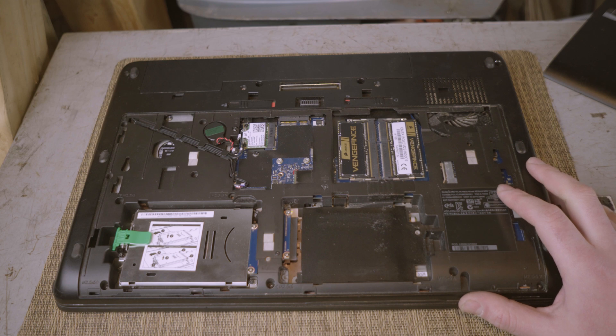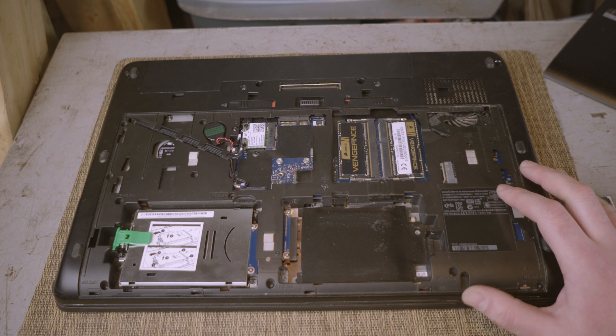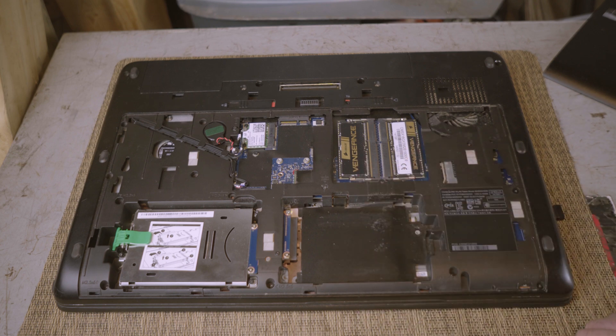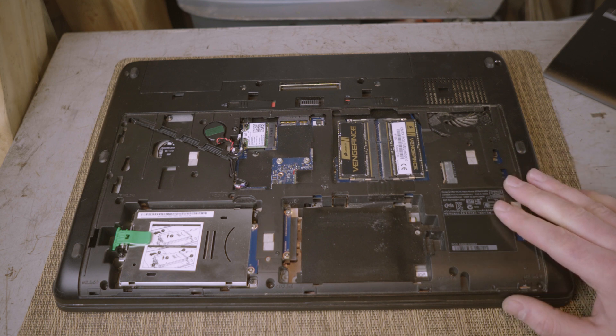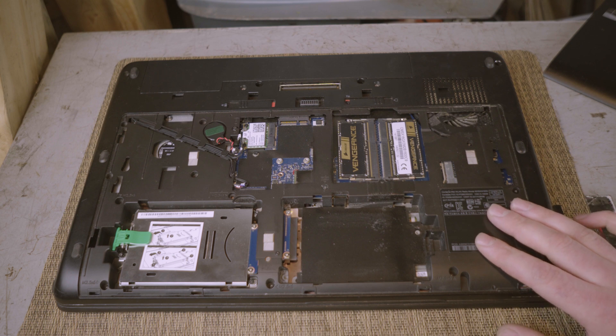When I took off the keyboard again, I decided before unscrewing the GPU and dealing with all the thermal paste, I'd remove the two RAM slots on the inside of the laptop that you don't normally see. I removed them, plugged in the laptop, and it powered on with no issue — it was honestly kind of amazing. I spent almost an hour fumbling around wondering why the computer wasn't booting and whether the eBay graphics card was bad. I then turned it off, put the RAM back in, and everything worked again with the full 32 gigs of RAM and no issues.